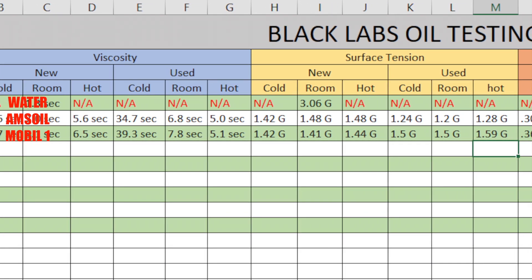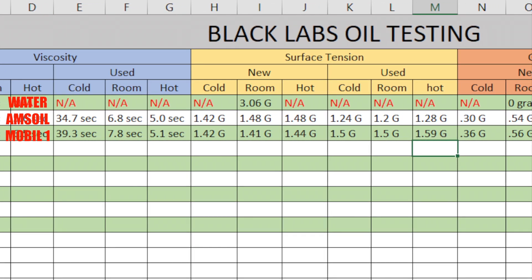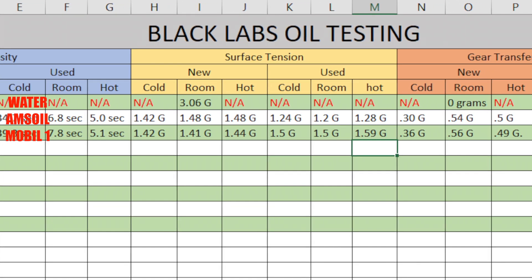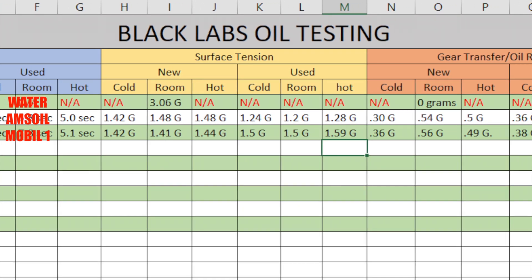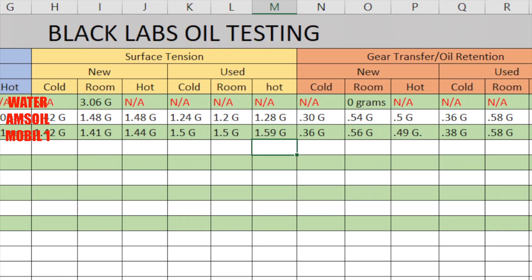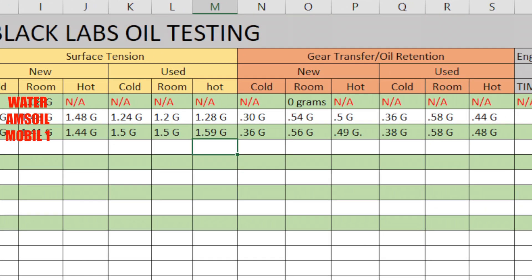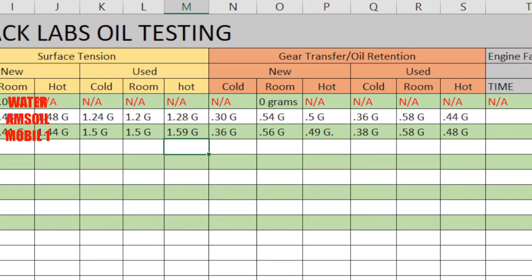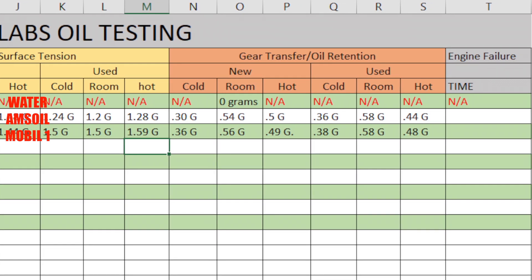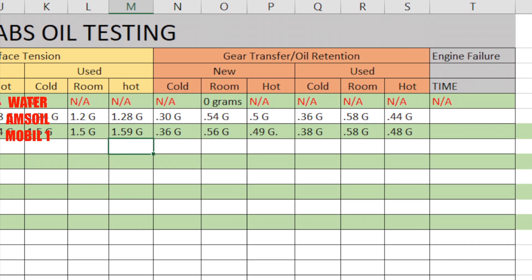The next video we're going to be blowing these engines up — I'm pretty excited to do that. We'll be filling them up with oil, running up to temperature, draining the oil, and then just letting them run. The engines will be warm, the oil will be warm so it'll flow right out, and whatever's left in there is what the engine retains. The engines will be tilted at the exact same angle and have the exact same amount of time to drain. You'll see I have the graph running right now — I wanted to make sure everybody saw everything. I might find a way to make it more public so everybody can access it without digging through my video. Until then, I appreciate everybody for watching — we'll see you next time when we go to blow those engines up.